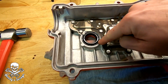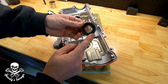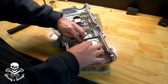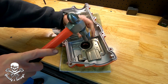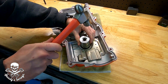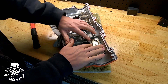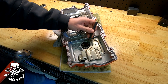You want them flush with the recess for the tube seal. The flat side recesses down — just set it in there as straight as you can, then use your socket and your hammer. It's pretty hard to mess up because it's only going to go in one way. Once it's seated, use a punch — be careful not to damage the seal — to push down that tab.